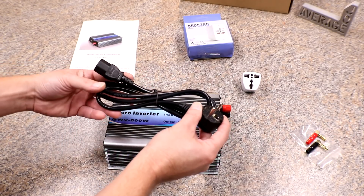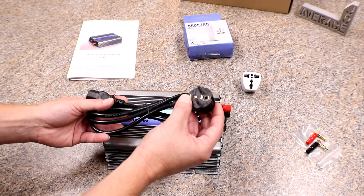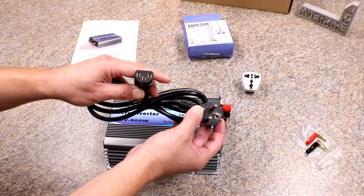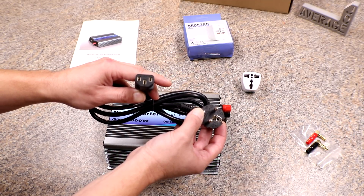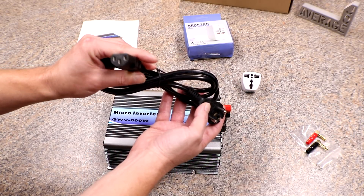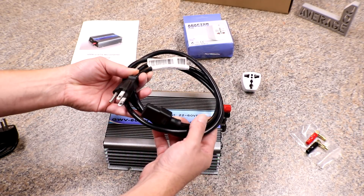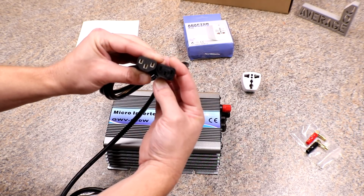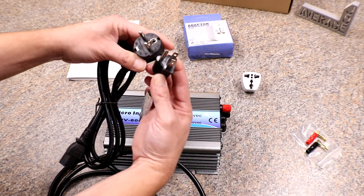At the beginning I mentioned that the only model they had was the European style plug, which isn't really a problem anywhere because this is the standard power supply plug — a plug that goes into a TV, a computer monitor, or a computer — so you can technically use any one of those. I would suggest getting one that can handle over 600 watts so you don't heat up any wiring. I have one from a plasma TV and we all know how much power those use, so this one should work out just fine. Here's a side-by-side with a European and a regular plug — they're all basically the same; the only thing that's different is this end.